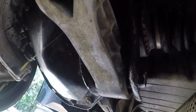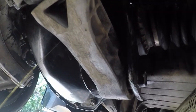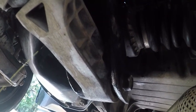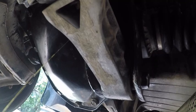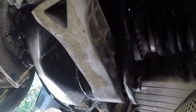That's good right there. Put your plug back in and you should be good to go. Wait for a little bit more — it's not that bad. Make sure it's not a big stream or anything, because overfilling the transmission could damage it. That's why you have to be careful.